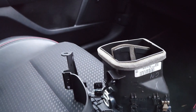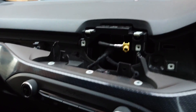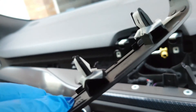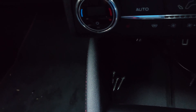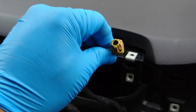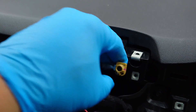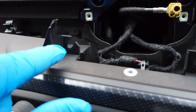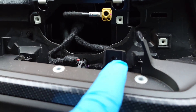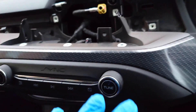The car is all in pieces. I'm sorry for not filming and showing you everything, but there's not much to it. To take the screen out, you just have a small plate on the back which pops up very easily. Then you've got three screws on the top — you undo those and the screen comes out. Be careful with the connector in here; there's a small tab you have to press. Use a small screwdriver to press in and pull out, otherwise you will break it.